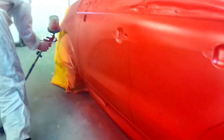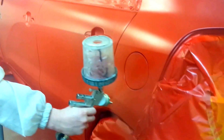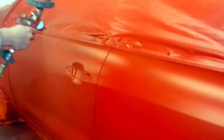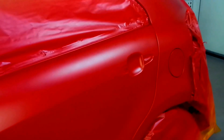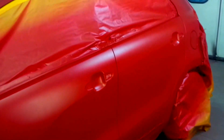This is actually his final coat — I couldn't remember if he did an effect coat or not, but that looks like what's happening here. The gun's a little bit further back; you could go a bit further than that even, but the idea is just to open up the fan, even things out, and make everything look uniform. Here's what it looks like all flashed off — or flashing off, I don't really recall. We usually give it about five minutes between each coat and maybe an extra five to ten minutes at the end before applying the clear coat.